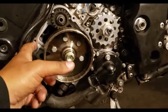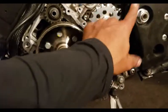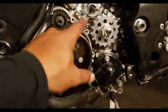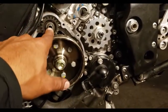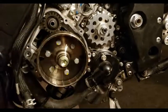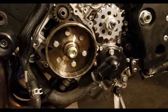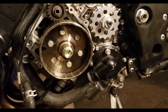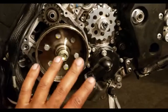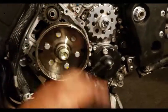I've got the stator cover off, and all of this is going to get painted. I wasn't going to paint it until I took it off and saw some scratches — since it's off, why not. When you're taking the stator cover off, these are going to be 8mm bolts. Be very careful because there's a lot of pieces and parts here on the starter gear. If you drop them or get the washers switched up, it can be a pain — on my last bike it sounded horrible when I accidentally got the washers switched. The cover is magnetized so you've got to give it a good pull, but try to keep everything in the engine or in the cover without dropping anything.